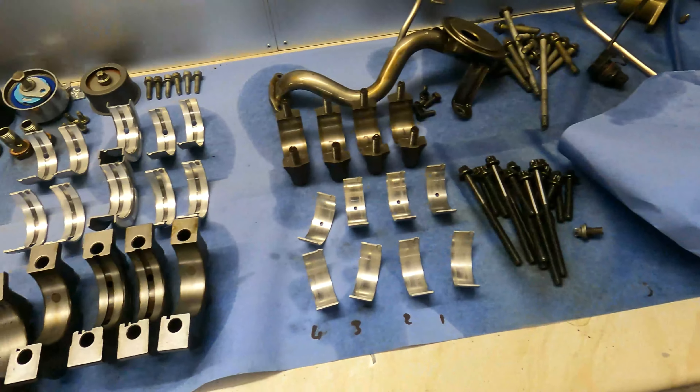New gasket — there's the oil pump back on. Someone on the original build noticed I hadn't quite lined these up properly, so on these ones I made sure we're super flush. Now I can get the cam belt back on and get this timed up. That's the cam belt back on, upside down which is a bit weird to do. When I took it all apart I couldn't set it to top dead centre — otherwise number one piston and rod would've been all the way down and I wouldn't have been able to get to it. So I set the crank up flat, which meant I didn't have any timing marks, so I put my own timing marks on and I've got them lined up.